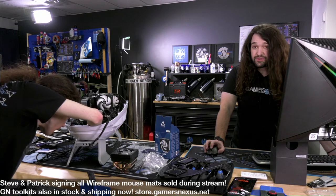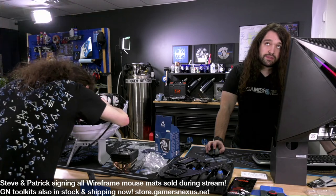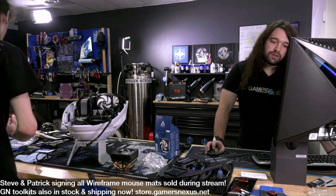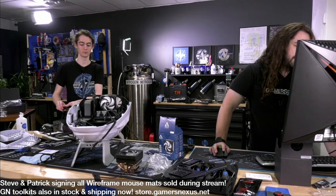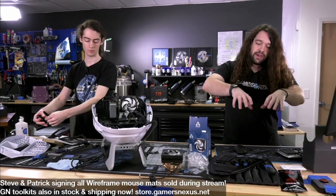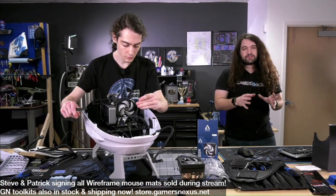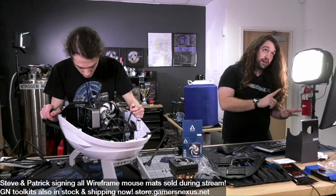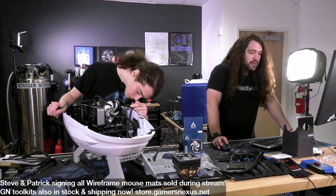Maybe, so first thing I would do is remount. Second thing I would do is make sure that if you're running auto voltage on the board, that is not stupid high. Maybe you can tune it down manually. And other than that, maybe a small mistake on the installation. Like you can try to grab the top of the D15 and try to wiggle it a little bit. Don't apply too much force. And if it moves, then the mount's no good. You said the mount's good, so I'm assuming you did that already. So check the fans are the right direction. Check the auto voltage on the motherboard. Those are the two things I would do. And I'd probably remount anyway. Okay.